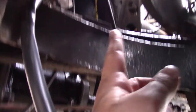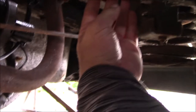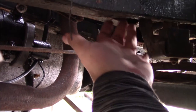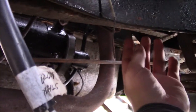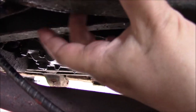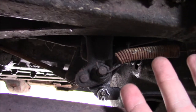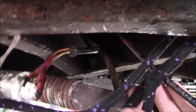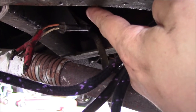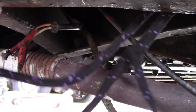When you're feeding the wiring through from above - because I can get my hand in through there to feed it - what I've found helps is pulling some excess through the chassis the way this triangular hole is here, and then sort of pushing it up. This section is blind until you get to this section here where it branches. You can just sort of get your hand in there and feel where the hole is but you can't see anything. You physically can't get around the chassis without dismantling the car, but with a bit of patience you can get everything through. Just up here is the brake switch, and this is the wiring for the brake switch, so I know I'm just about in the right place with this loom so far.